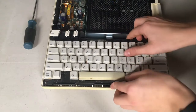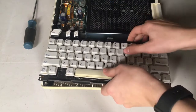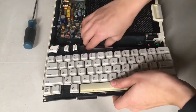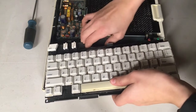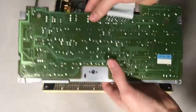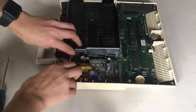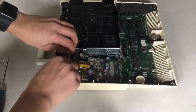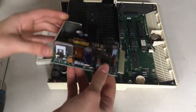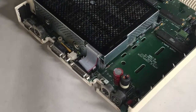The next thing to come out of the machine is the keyboard. It's fairly simple to remove - all you really have to do is lift up on it and then pull it outwards as it clips into the disk drive, and then there is a cable you will have to remove. Next I'll unscrew the two screws holding the power supply in and lift that out as well - it slides back and then lifts up. Interestingly enough this one is smaller and doesn't have the RF shielding that you usually see on these things, and it appears to be made by Aztec.